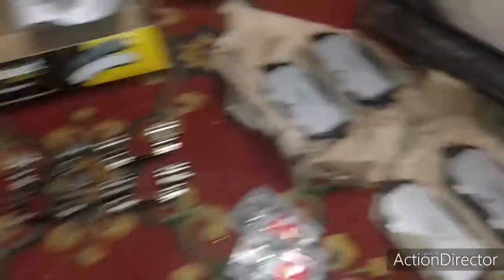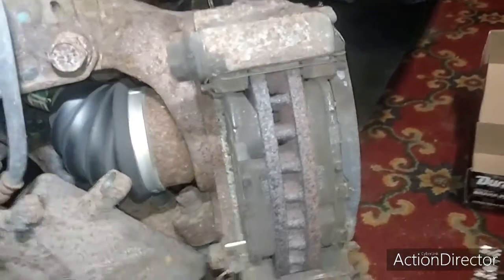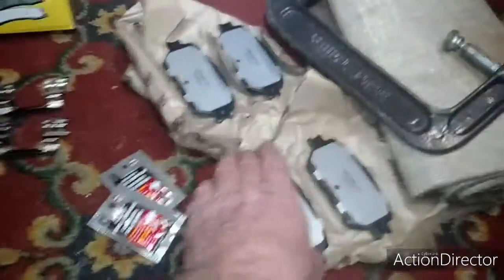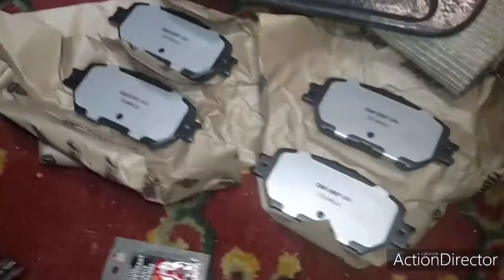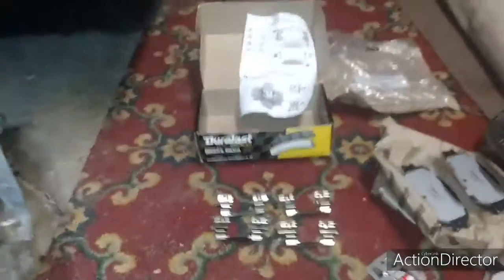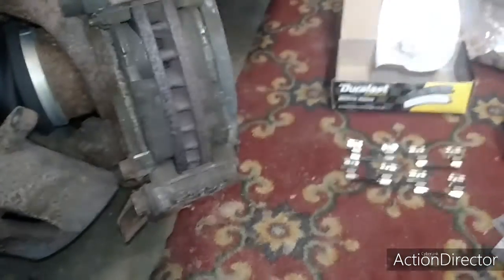That's interesting. I wonder why I got a lost brake pedal — I mean, not much loss, just a little bit. So anyway yeah, what you would do is pop these out and then slide the new ones in. On the 2004 I noticed these are all the same, so it doesn't matter — they're not marked inside or outside or anything like they are on some vehicles. Well, I'm kind of glad I can go take these back and get my $50 back unless the other side is bad.